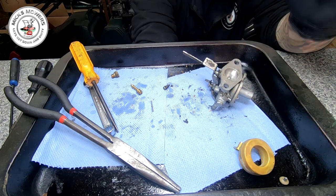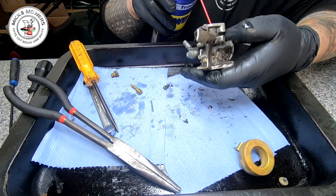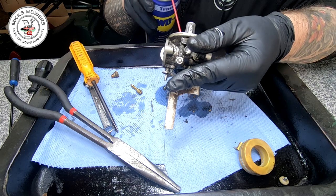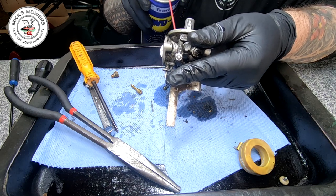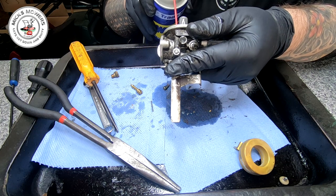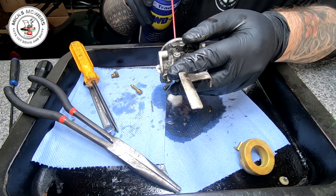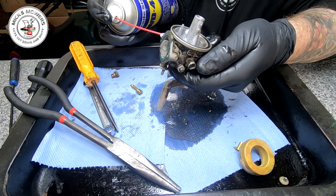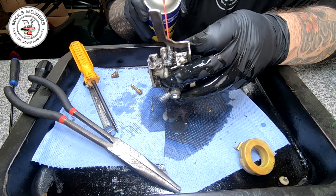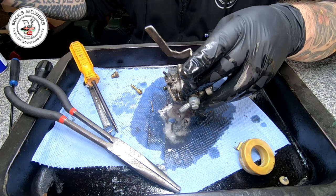Let's get a bit of WD-40 now and give that a bit of a clean up. We've got a hole just there — that's coming out of there as you can see. We've got a hole here — that's coming out of the other side and out of the bottom. We've got a hole here — that's coming in reverse, down through the main tube, through a little tiny eyelet just there, through the fuel intake, and then through the fuel mixer screw. That's all good. Let me give it a quick blow from the air compressor.